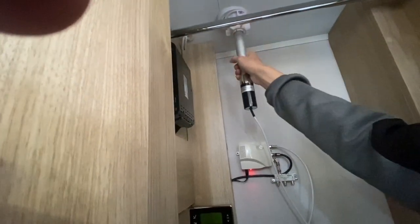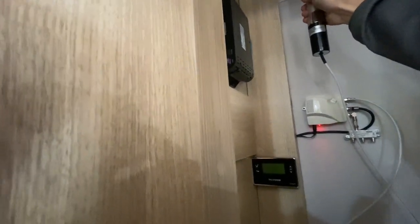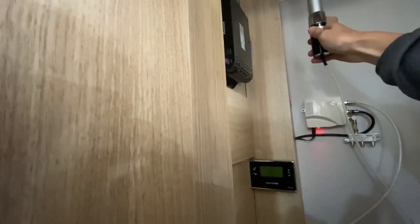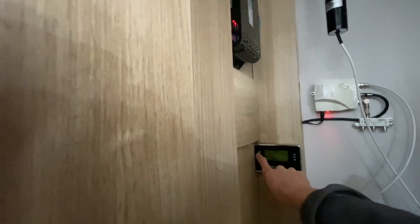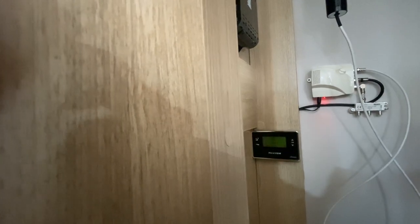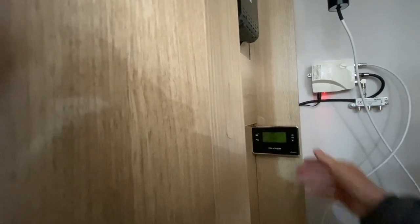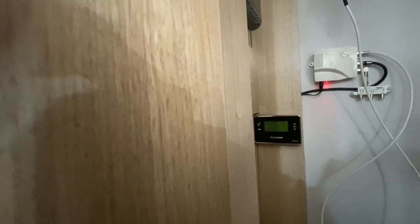This customer has opted to have a satellite system added — these don't come as standard on the Signature 155. To operate the Maxview sat system, turn on the box — this sends power to your control unit. Press up to send the dish up; it will automatically find Astra 2. To change satellites you can go up and down, but it's Astra 28 for this country and France.